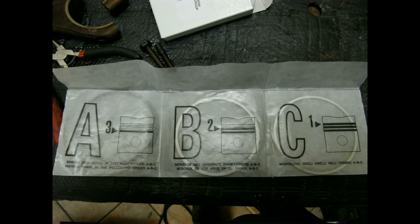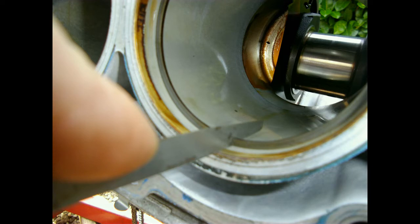The first goodie is out of the box — a set of brand new piston rings. BMW does a great job in packaging; even when you're in doubt of what has to go where, there is absolutely no question about it this way. Although it is original BMW and they look wonderful, I still have to measure them up before installing. The gap has to be 0.6 millimeters or 0.024 inches — you call it 24 thousandths I think. If not, educate me in the comments.